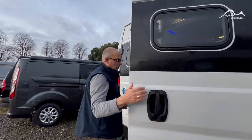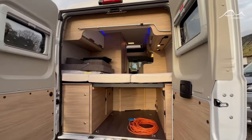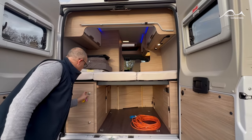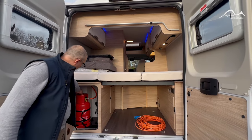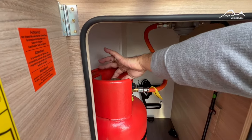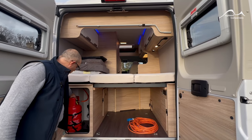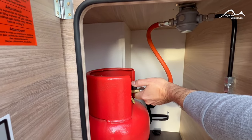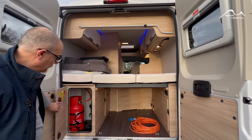When we come around to the back of the vehicle and open up the back doors, on the left hand side you've got access to your gas bottles. We've got one gas bottle in here at the moment — this is propane, designed for winter use. You turn the bottle on and off at the brass tap. Adjacent to it is a crash point, so you need to push in on that for about three seconds or so and that allows the gas to go through. These can reset themselves if you go over a bump in the road.